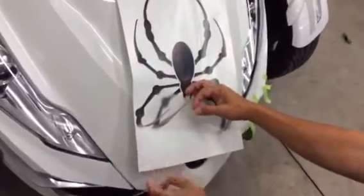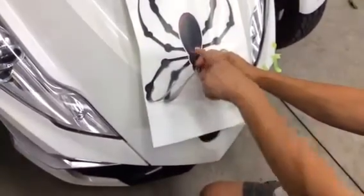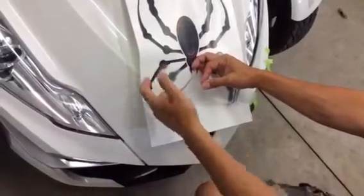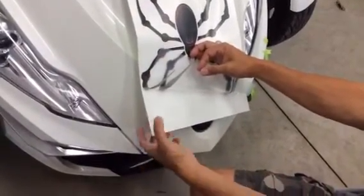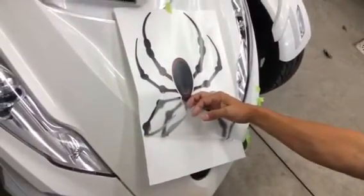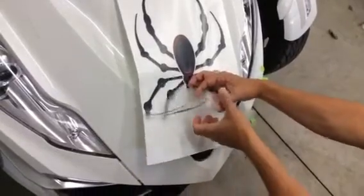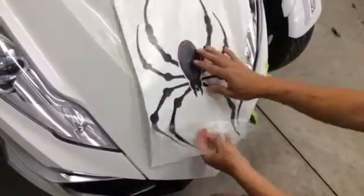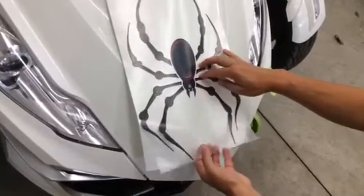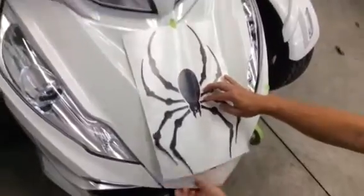The way this graphics kit is made, you have basically three layers: the bottom paper layer, which will end up being garbage; the adhesive side of the decal itself; and then this clear plastic material, which is the transfer tape. The paper and the transfer tape will both end up being garbage when we're done. The transfer tape is what keeps the spacing of the graphics together and holds them in position.